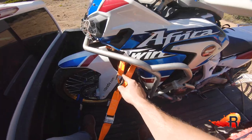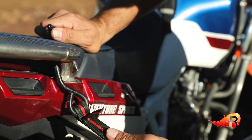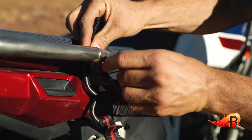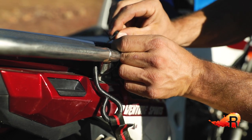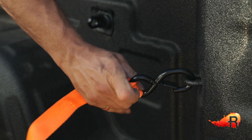It's a little unlikely with soft straps, but hooks can pop out without closures. If you don't have closure built into your tie-down straps, consider using simple zip ties or something to create a loop and hold that strap in place so it doesn't come off the hook.